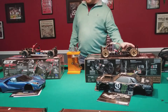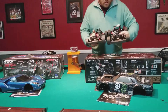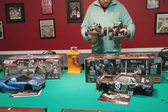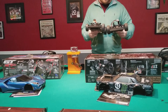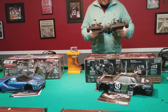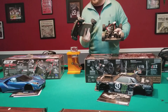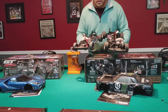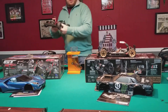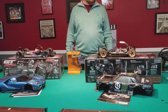The general suspension layout is very similar for both front and rear - the factory setup is very close. The only additional adjustability on the Traxxas front end is two holes on the C-hubs that allow you to change the angle of the lower arm. There does appear to be a little more adjustability with the Traxxas chassis than the HPI, though aftermarket parts would let you customize either one.